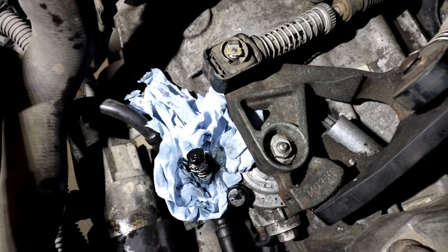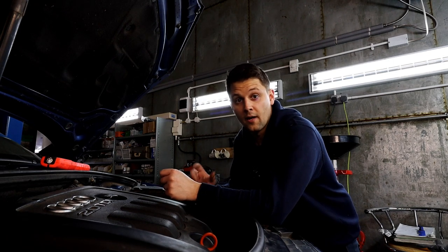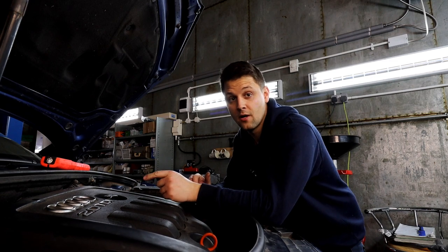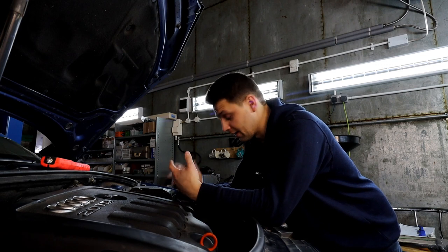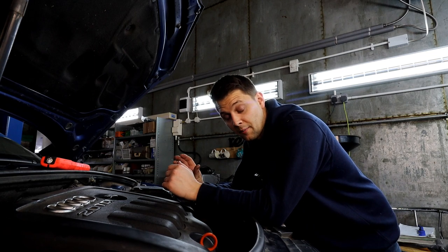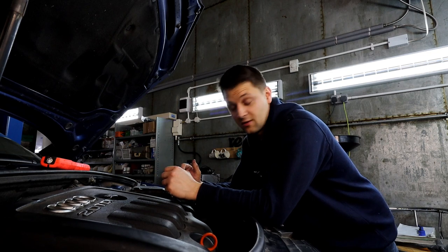Don't forget to keep an eye on the brake fluid level. Once there's no more air, your pedal should feel fine — that's the procedure to bleed your clutch. In my case, after replacing everything, I undid it and let it bleed for quite a while — a lot of air came out. I kept topping it up, and when I tried the pedal it started feeling a lot better. In the beginning I only had half of the pedal force, but now the whole pedal goes up and feels much better. After bleeding it once more, a lot more air came out and the brake fluid is coming out quite clean.